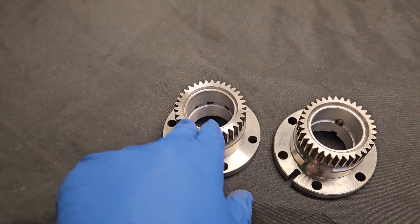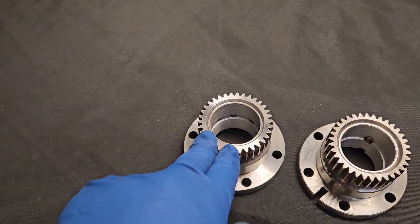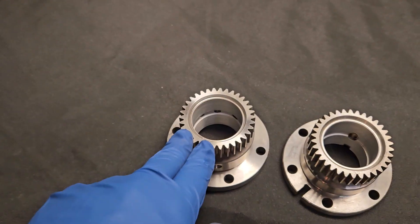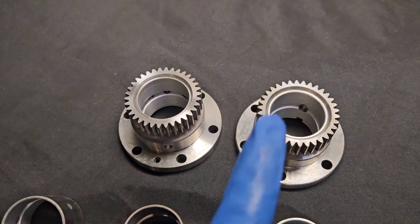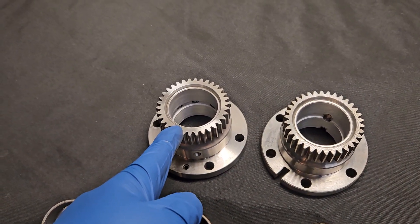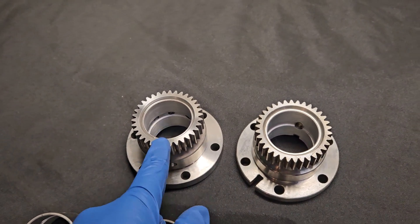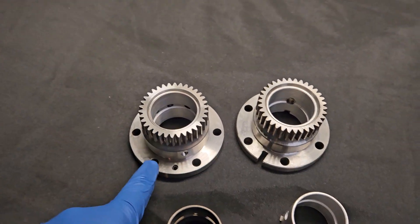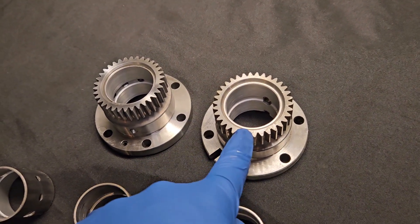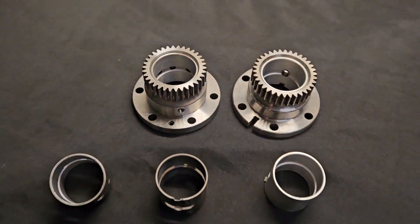If you're applying this and you are planning on getting to those high RPM, high horsepower, higher-end levels, then you're probably going to need to back it up with oil pump and regulator upgrades as well. Even though Mazda Competition discontinued the multi-window 12A, if you do some internet searching and talk to MazdaTrix or the rotor shops out there, you can find them. And this is just a good old 12A OEM gear from the 80s that we cleaned up for the video — still remarkably usable and in good shape.